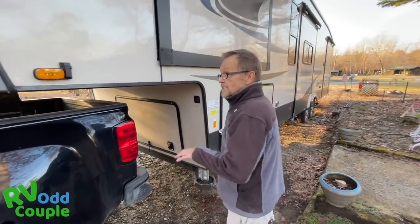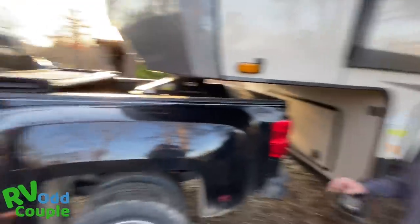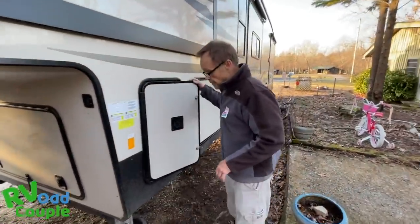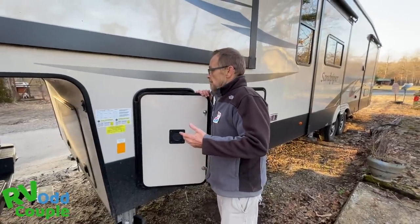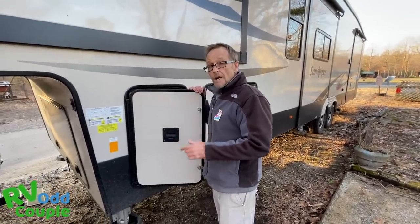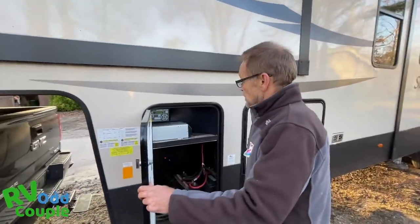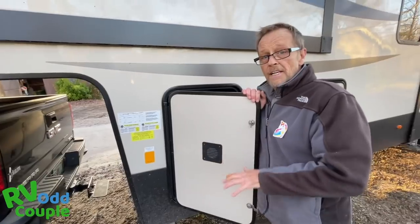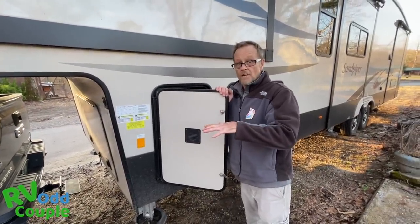Now that I'm blocked, Mercedes, the baby, and Skip are in the back of the truck in a safe place — not running around here. I'm going to go to my landing gear. Some RVs have manual landing gear, which can be good because when you have hydraulic or electric landing gear, things can go wrong. That's one of the things that happened on this day — our batteries were dead. They're fully charged now, but if you cannot drop your landing gear, you're done.